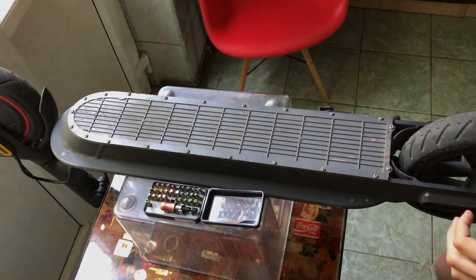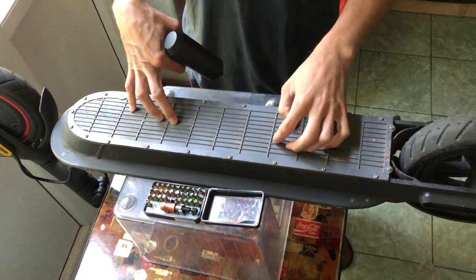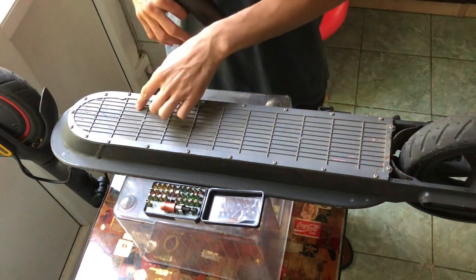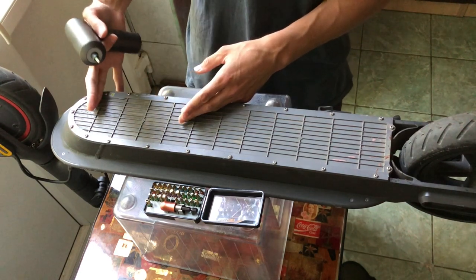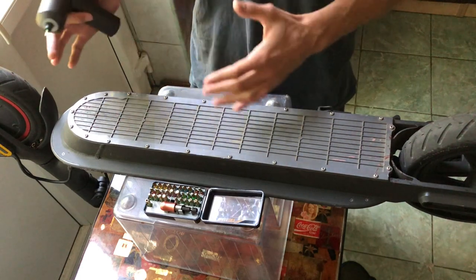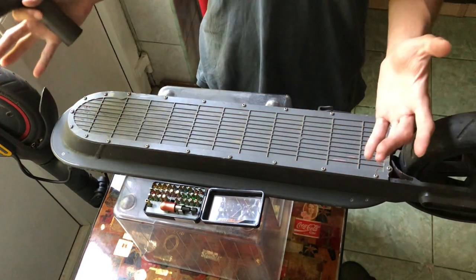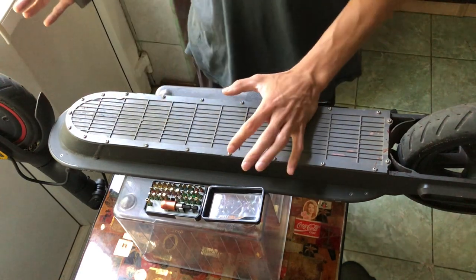All right, so I have it on super good authority that if I take this back cover off of my Xiaomi Pro 2 electric scooter and reinforce the controller, I can set the maximum in the custom firmware to 35 amps, and that would roughly pass about 1,000 watts through the controller into the 350 watt motor. So that will definitely not be sustainable long-term uphill.